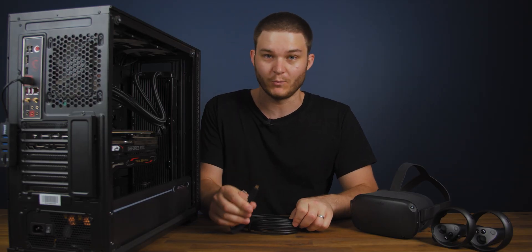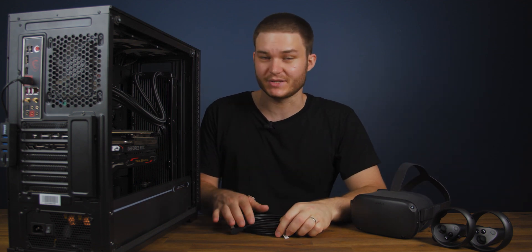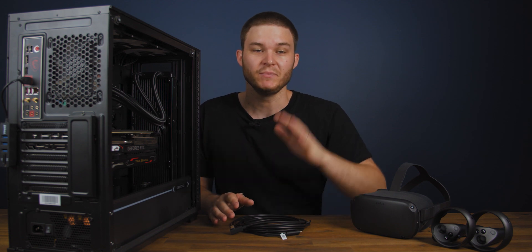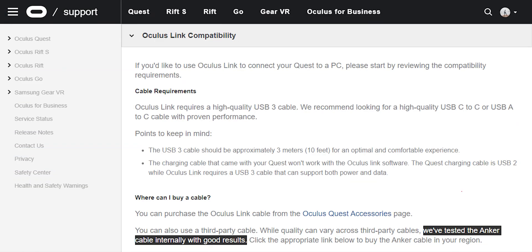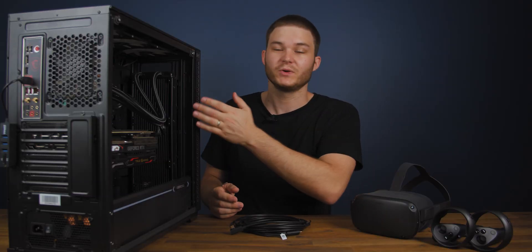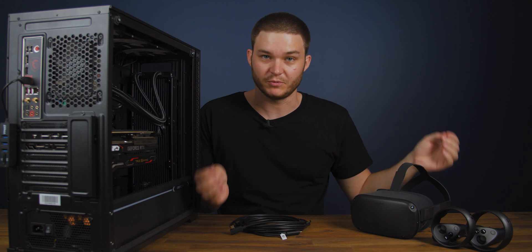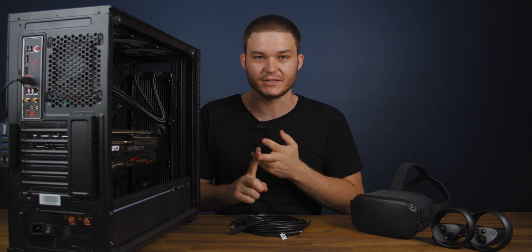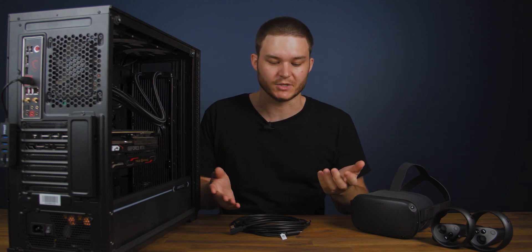As far as the cable goes, it needs to be USB 3. It has to have USB-C on one end to plug into the Quest headset, but it can be USB-C or A going into your PC. The Anker 3 meter cable, which I'll link down below, has been tested by Oculus and they've said it works fine. However, this cable is only 3 meters long, meaning you can only go 3 meters from your computer to your headset for tested performance. You can get extensions, active cables, things like that, but you're adding to the bulkiness and more points of failure in your system.